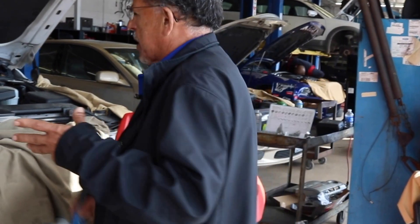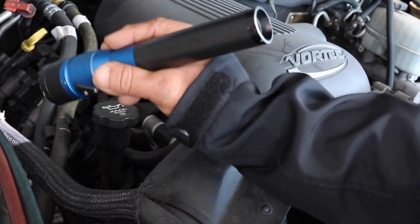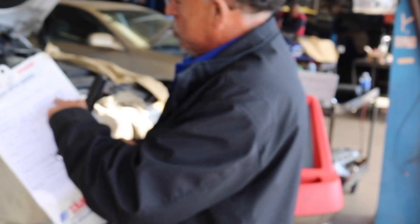I recharged it. If you come over here, these are the hoses. Your big hose is usually your low side and your small hose is usually your high side. If you see something oily, that means you have signs of a leak. This particular vehicle was low on refrigerant — we took out two pounds and it takes three. It had 45 degrees, still cold for most people. When we got down to 40 degrees, it went from 25/125 to 33/140.